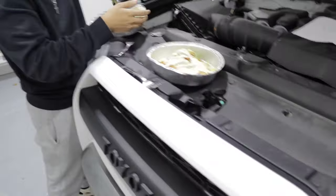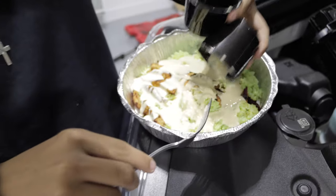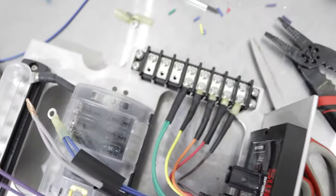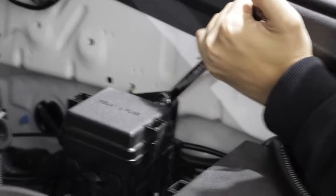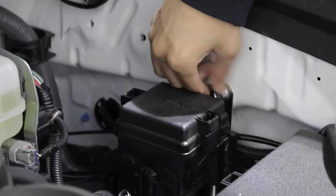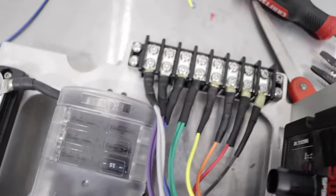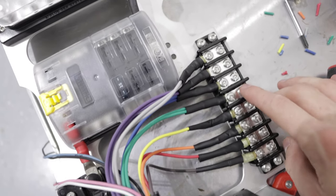Taking a little dinner break — no better dinner than on the engine bay. Back to it: still got three more wires, and Tippo is doing his thing inside the engine bay. We're taking off that relay fuse bolt because we're going to be using one of those holes to mount the Switch Pro into the engine bay. That hole right next to his hand is the other hole we'll be mounting into, getting the engine bay prepped. We got all the first wires lined up and put into the terminal block in order: brown, red, orange, yellow, double green, double blue, double purple, then double gray/white.